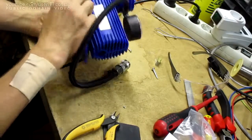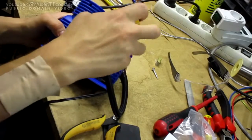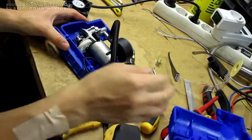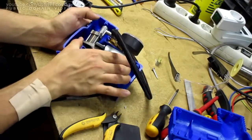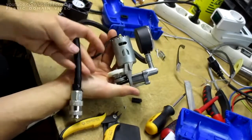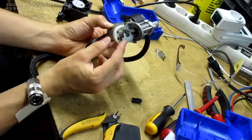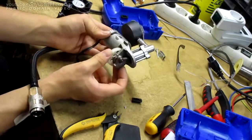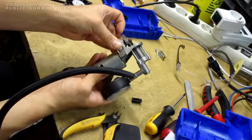Let's see if it comes apart — and one more screw. It's a little 12-volt thing, by the way — it has just a cigarette lighter connector, and probably current limits through just the resistance of the wires. That comes apart. That's a pretty sturdy little assembly. A plastic cog, which is a bit disappointing. We have a counter-balanced little tiny compressor — look at that. It's a cast cylinder, and it's probably all cast steel. That's not too bad.